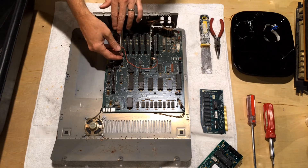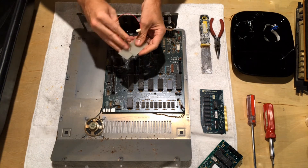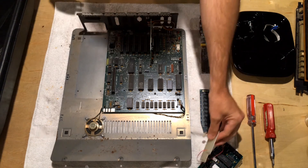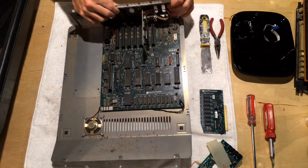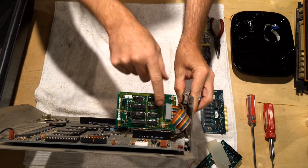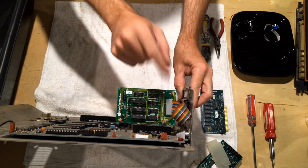They also had a blank card here that was inserted, and these can be really difficult to pull out sometimes. There's really nothing to it except a single connector, and I'm guessing this provides an extra power rail for that card. Once we've removed all those cards, you can see I also have an I/O controller here. The ribbon cable connection is kind of stamped down into the connector and doesn't easily come off — if it does, you're going to have a hard time getting it back on.